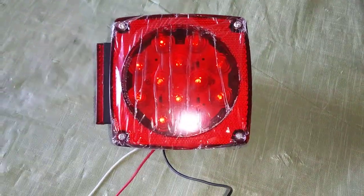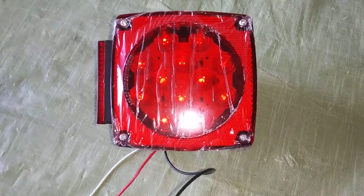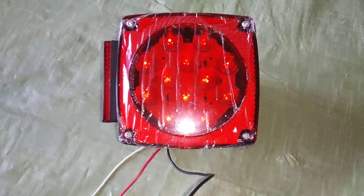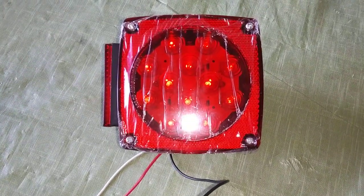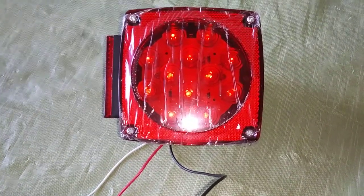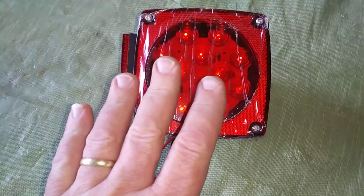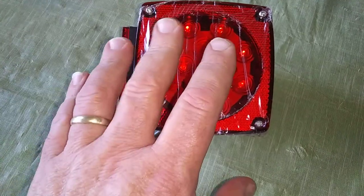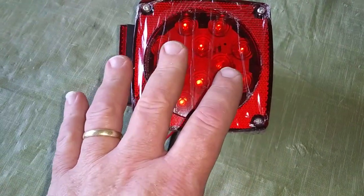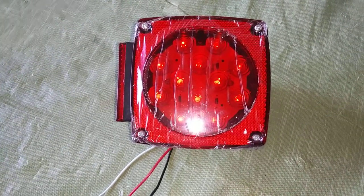You've really only got two functions with trailer lights. You've got your running lights that come on when you turn on your headlights — that's a softer light. Then when you indicate for a turn and put on your turn signal, that light, instead of being on solid, gets broken and starts flashing. So you've got a softer light for nighttime driving that will flash when you use your turn signal, day or night. The second function is a brighter light, which is for your brakes.